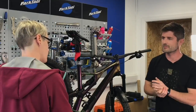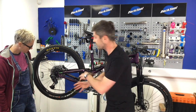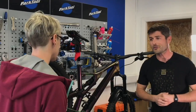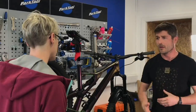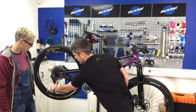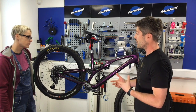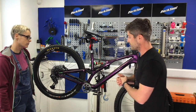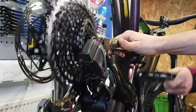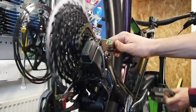And then there are two clutches in here. Inside the derailleur, you've got the battery you can see at the back — it's all self-contained — a motor and a gearbox that actuates the movement. To protect it for mountain biking — knocks, tumbles, mud, rocks — there are two types of clutches. One is your derailleur clutch, the Type 3 roller bearing clutch, which keeps chain retention. The second is what we call the overload clutch: if a big rock strikes the derailleur from the side, instead of bursting into pieces or bending the hanger, it moves over on a clutch and then comes back into its original position.